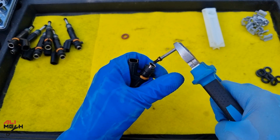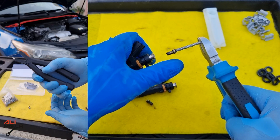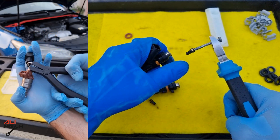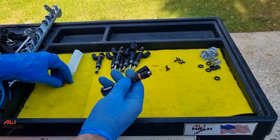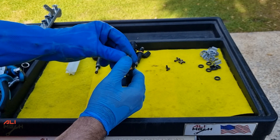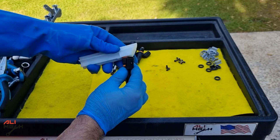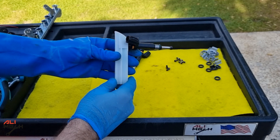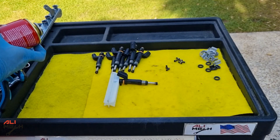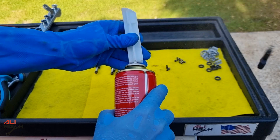Next, I will remove the fuel injector filters with a screwdriver — before cleaning and after cleaning we will put new ones in. You can also use specific fuel injector filter removing pliers; I'll put a link in the video description below. I'll use a universal fuel injector adapter for cleaning. Make sure to use a separate O-ring if you are planning to put the old O-rings back. Using the fuel injector adapter is easy — you just put an O-ring on the fuel injector and insert it in.